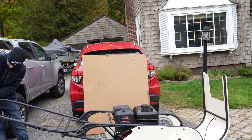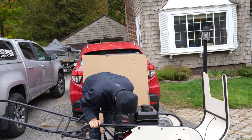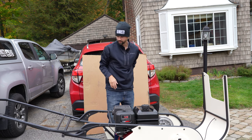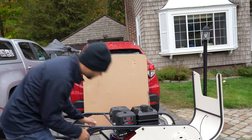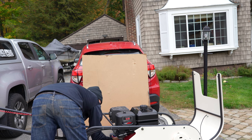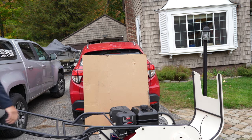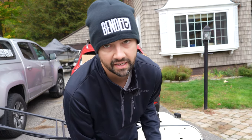We are going to put the parking brake on. Make sure everything's good. My old model had a key start to it, so I'm going to make sure there's a key somewhere — I don't think there is for this big one. Make sure lights are off. Run is on. Kill cord is on. Choke's all the way on. Fuel is on. Double check the oil. Let's give it a pull start. That was easy. Backing off the choke. We're going to let that warm up for a second. Let's go get the sled and get that unboxed as well.